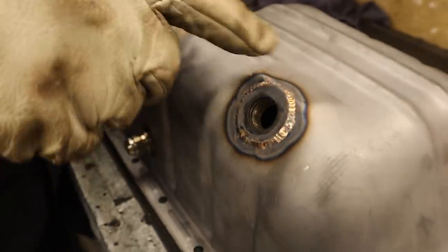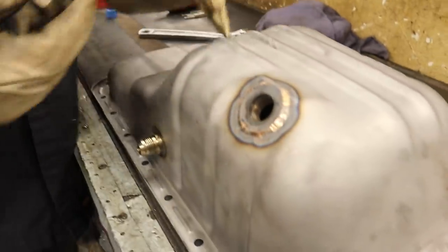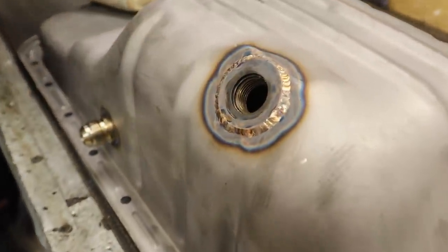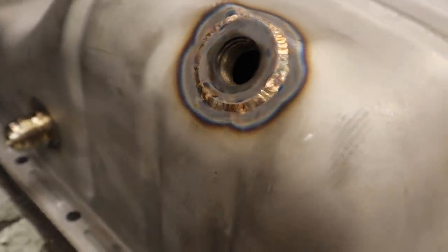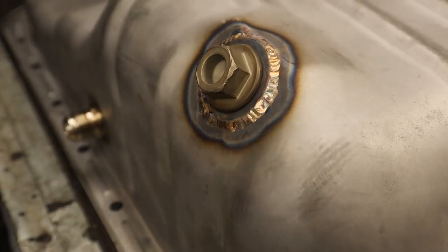So you can see it's kind of gold looking. Okay, so here you said we use silicone bronze. Silicone bronze because it's thick and thin. The pan is thin and that washer was thicker, and then we still have an even thicker ring in there. But look at that. Gorgeous. And now we have a nice strong flat spot that the gasket is going to seal. We're done with any problems there. Flawlessly.